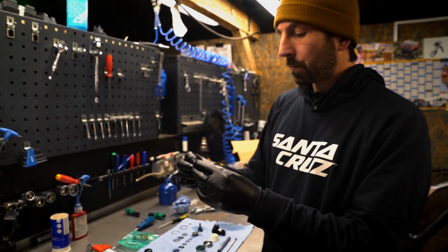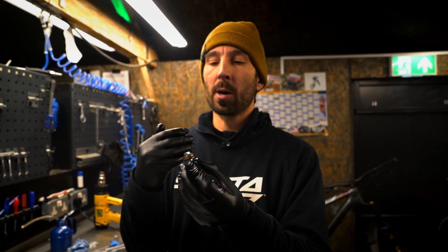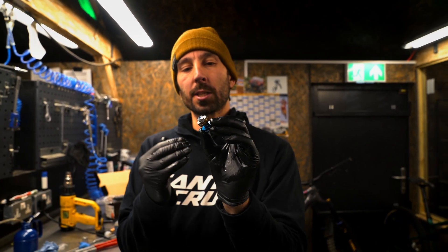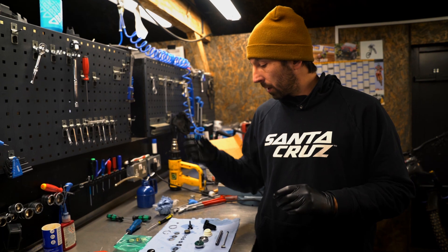The rest of this is the compression valve. When we talk about tuning with Ohlins, all we're doing is controlling how much fluid is displaced into the same shim assembly. The fewer shims we have, the less fluid is displaced into this valve. So those are all the bits — that's what everything does.